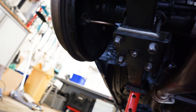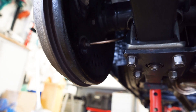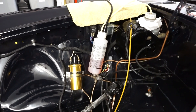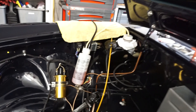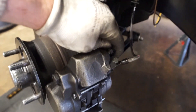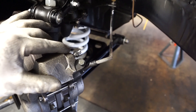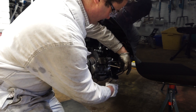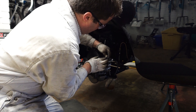I'm going to do exactly the same on the driver's side of the car but won't film that. Both rear wheel cylinders have been bled and we've got around a third of the brake fluid left in the container, which should be enough to do the front brakes. The front brake bleed nipple is similar to the rear — it's on the top here and that's an 11mm spanner to undo. I'll hook the jam jar over the line there and get the hose over the bleed nipple.